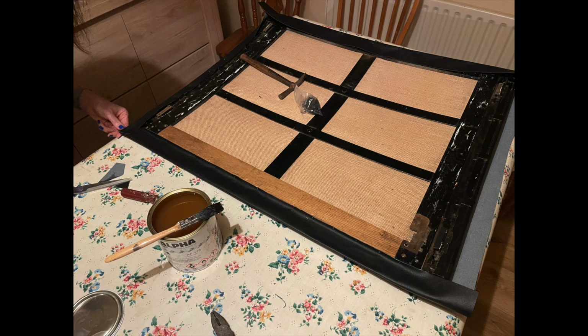So here we get a better view of that front edge, which goes above the windscreen. So you can see the pot of glue here. We've used a liberal amount of glue to keep that fabric nice and tight to the metal frame, and also to make up the corners. It was suggested that we use a liberal amount of glue to make them up too. And the idea here is that we keep the fabric nice and tight.